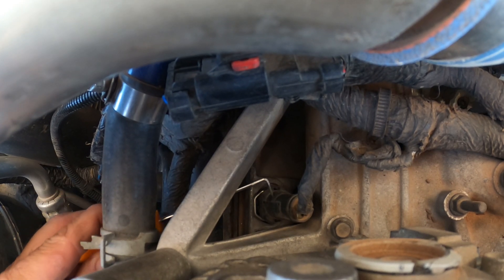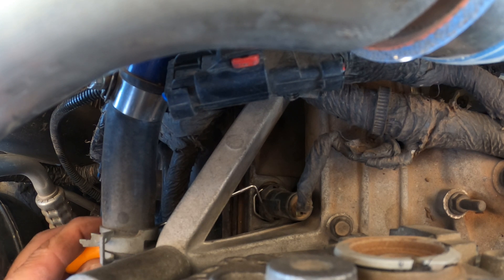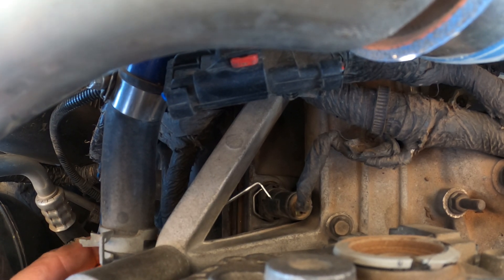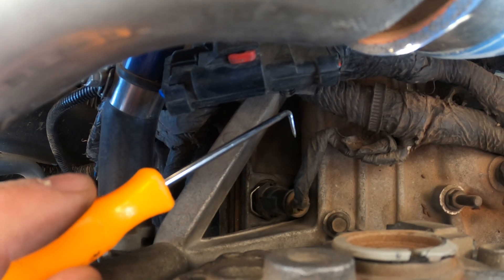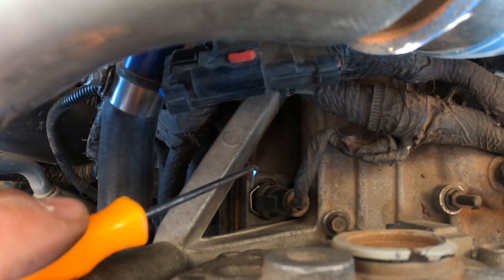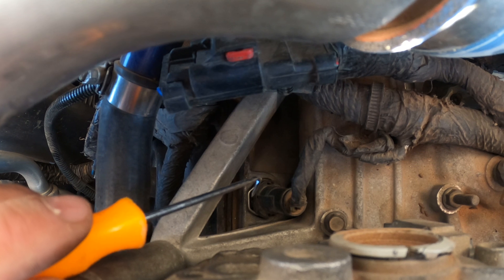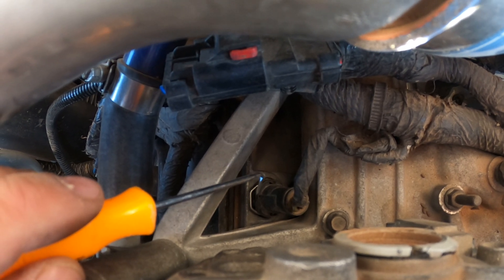This is the injector harness right here — see this little metal clip. That's why I got this o-ring remover; you've got to pull that out a little bit. You've got to be really careful because I've had one of these fall underneath the intake before and had to literally take the intake off to get the little thing — and they're also very expensive from Ford. Now that you know what's on each injector harness, I'm going to get that pulled off.